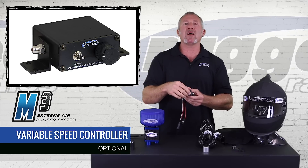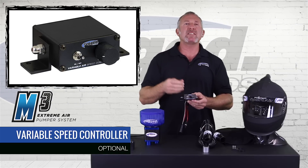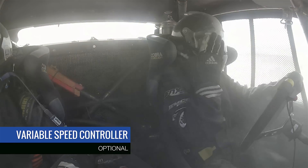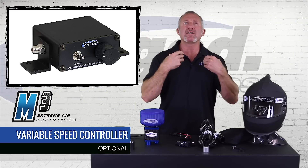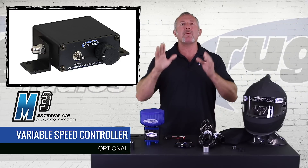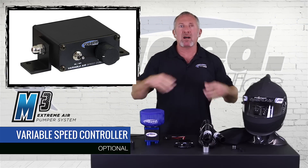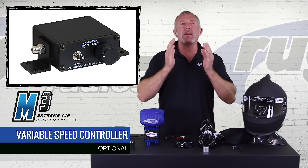Turn it on. For staging, you don't need a lot of air — you can turn it way down, just defogging the shield and keeping you comfortable. But say you're racing and you hit that silt bed. Silt goes everywhere, in through the shield, into everything — it's really hard to deal with. You have your skirt on your helmet going around the bottom. You hit a silt bed and all that silt comes inside the car. You turn the VSC all the way up to maximum pressure. It pressurizes the helmet and pushes all the dirt and silt out the bottom through the skirt and any opening.